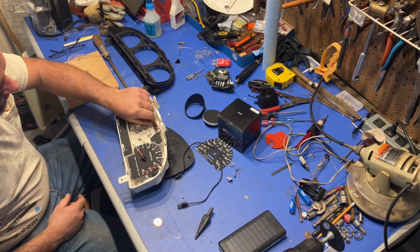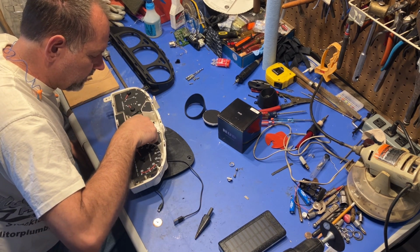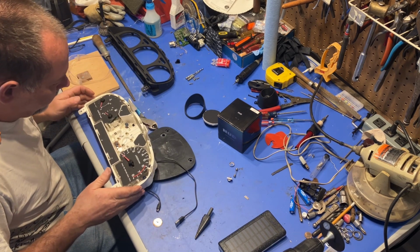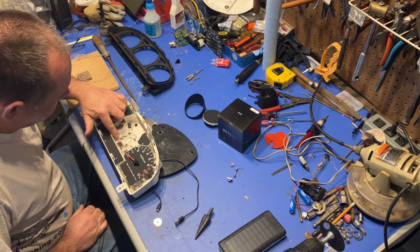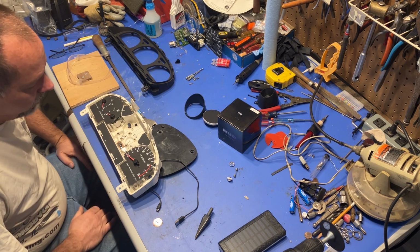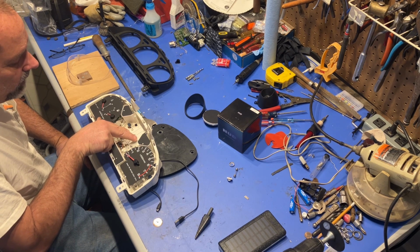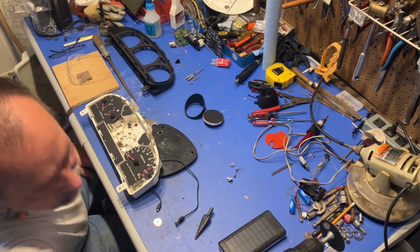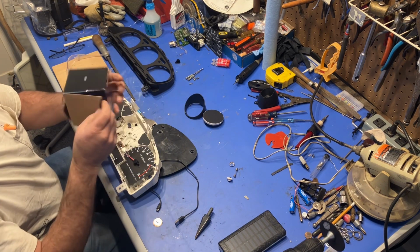And even with the speedometer mounted somewhere, actually right down there in the bottom would be just about ideal if I can pull that off, because this wire can go right under that screw and this wire can go right under that screw, and then we have our 12 volt to 5 volt power right there. The variable signal from the speed sensor, we don't need, because remember, this is GPS. It's in there. Nothing. Twist tie.